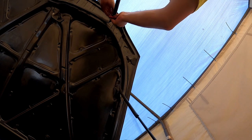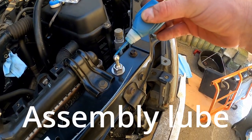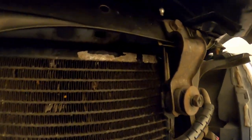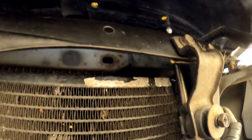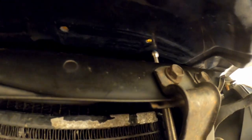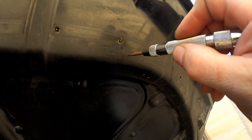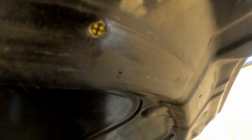One of the reasons I like assembly lube is it stays wet forever. We just go boom, like that, and that gives us as close to where it needs to be as possible. Need to drill a hole there. I put my hole punch into the centre of the assembly lube and just pop it. Even though it's not metal, it will leave an indent and help you to line up your drill bit.